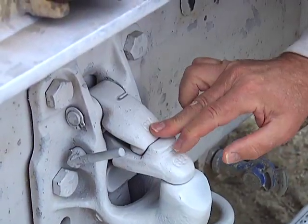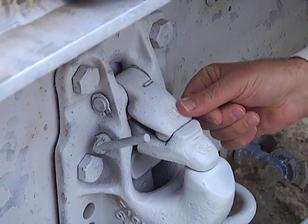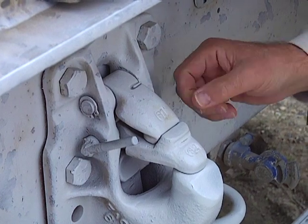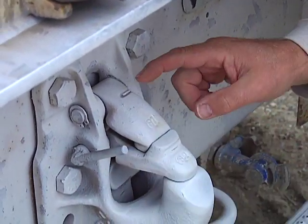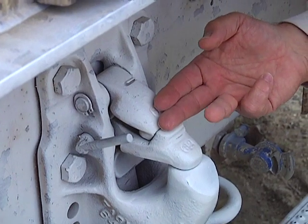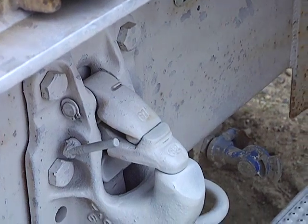When the air hoses are connected to the trailer and the driver releases air to activate the back trailer, there is a mechanism here — a plunger — which will come out and snug the I-hook so that there wouldn't be excessive play, which would wear out the stout iron on the I-hook. It serves as a further safety precaution. This locking latch, once it's down, is not supposed to come back up when the lever is pushed in. It's spring loaded so that as you're going down the highway, vibrations won't release it. If the spring is not doing that, it needs to be replaced.